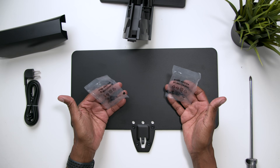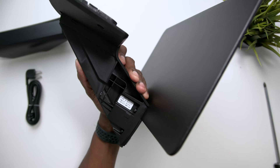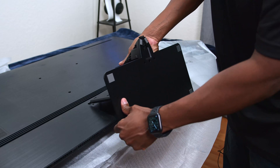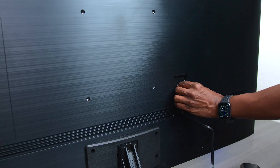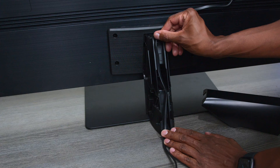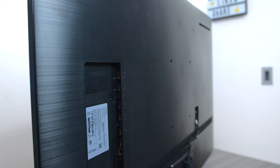After grabbing the base, you can see there's a notch here — just slide it on and it's locked in. Then take these four screws and insert them in. Once everything is mounted, there's a little lip on the TV — lift it up, make sure it's lined up, push down, and insert the four screws into the back side. Then plug in the power cord here, make sure it's snug, run the cable like this, and snap this piece into place.